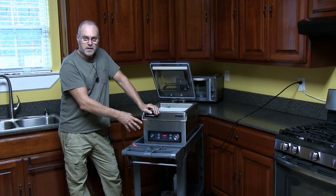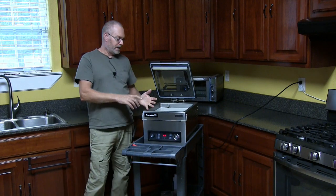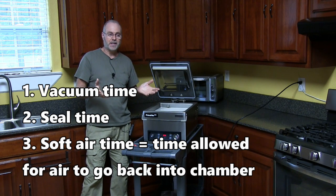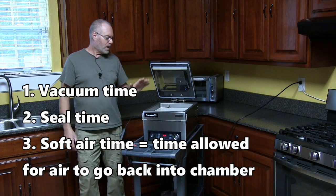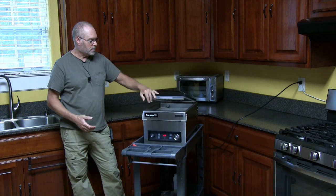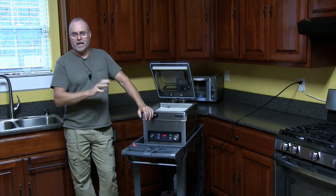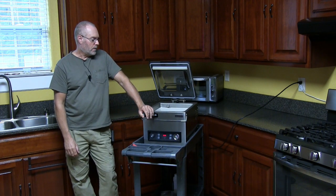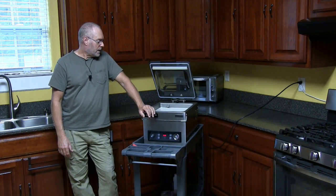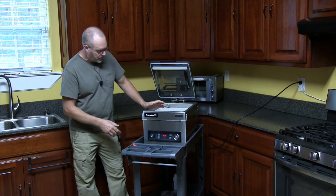You have some program options in here. I'm not going to go through all of them. They're very simple. You just look in your instruction manual, but you can control the amount of time the vacuum is vacuuming, so from I think it's 10 seconds to 60 seconds. Now I left mine at 60 seconds vacuum time, so it'll suck the air out of this chamber when this is closed for 60 seconds. Now they say that this will remove 99.9% of the air out of the package that you're vacuum sealing. That's pretty darn good, and I think the only way you're going to achieve that is obviously leave it at 60 seconds. So I'm just leaving it at that. But it is programmable, so you can change it.